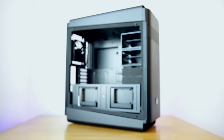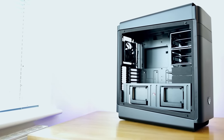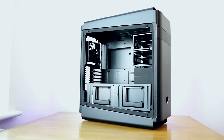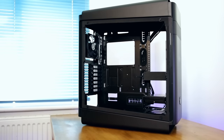Once inside, you'll see it's fairly roomy. There's a unique feature I haven't seen before — you have two 2.5-inch drive bay caddies for SSDs or hard drives that cover the lower section of the case, so while it looks like a basement, it's not a traditional basement. This works fine if you have two SSDs, but if you only put one in — or if you have unattractive SSDs — it's going to look a little bit strange. Thankfully you can remove this, though you lose the basement functionality. The caddies also have built-in LEDs that you can hook up to a motherboard or the case's controller for some RGB highlighting of your SSDs.